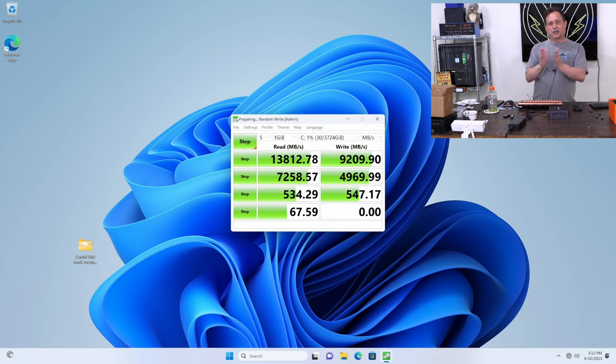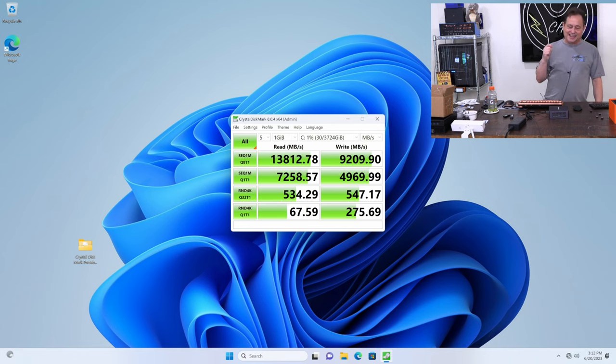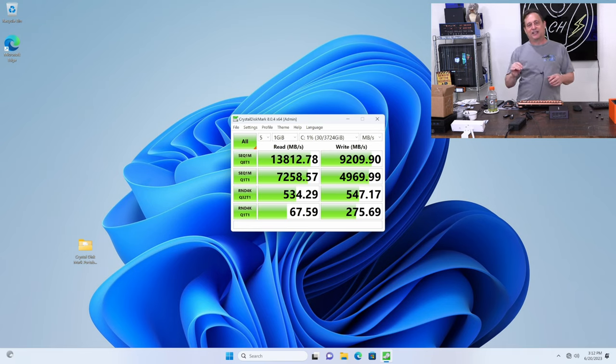If you want it to see the drives working together in a RAID array, then you have to have the driver on anything you boot from. Any sort of rescue disk, any sort of utility, anything that you boot from must have the RAID driver as part of its boot process, or you cannot see your storage. And that's why it makes it a pain in the rear end. Right? Something we take for granted, oh, we'll download a utility online, we'll use that to fix our computer, and then it can't even see your drives. So that RAID driver is absolutely critical, and you want to make those boot disks while your system works, because trying to do it after the system crashes makes a complicated job even more complicated. Ask me how I know.